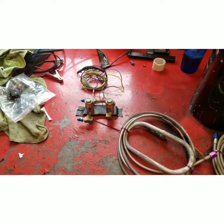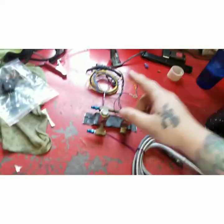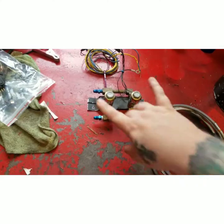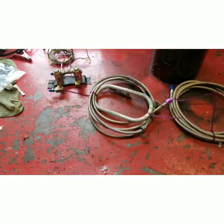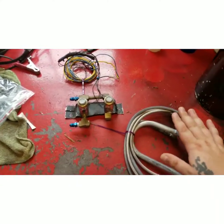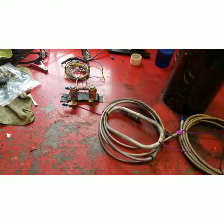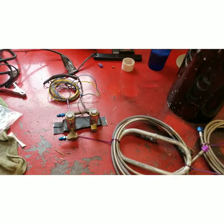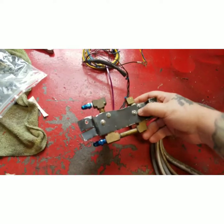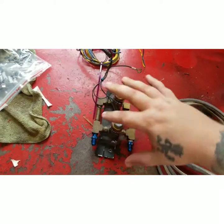But like I was saying, one was used for purge and one for the intercooler sprayer. I'm not gonna use a purge — it's just a waste of CO2. It's kind of pointless because it only runs off the pressure of the tank, so however much pressure the tank puts out is how much comes out of both at the same time. You can run 40 solenoids off one tank and it'll essentially do the same thing, unless you're putting them in different places — like one to the spray bar and one to the radiator. It doesn't make sense to run two, so I'm gonna dismantle it down to one.